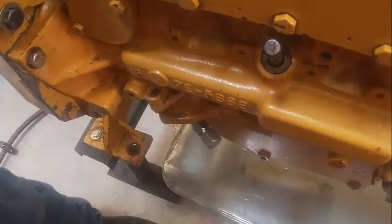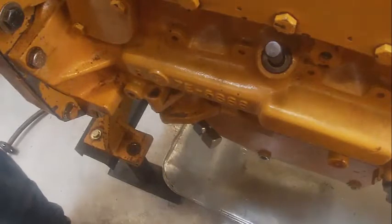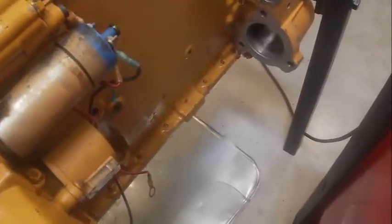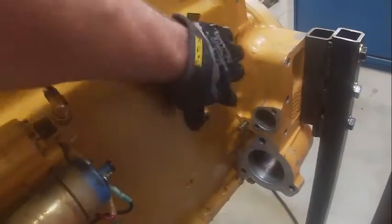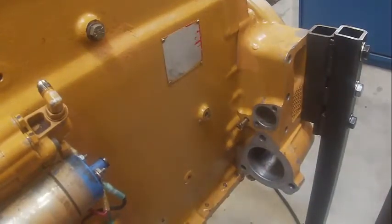This one here. As I turn it on the front, you can see the pin drop down. I can't turn it — I can see it moving there. Our pump is pinned at top dead center number one. Back here we have where we locked our timing pin in with our turning tool. So the engine is locked at top dead center — basically what we'll do is torque those bolts down now up on the front and it's timed.